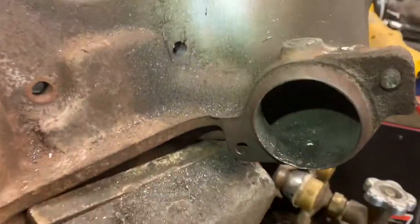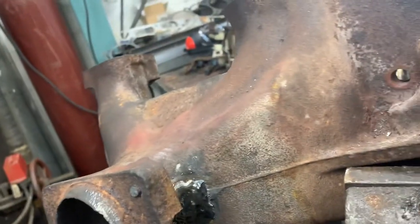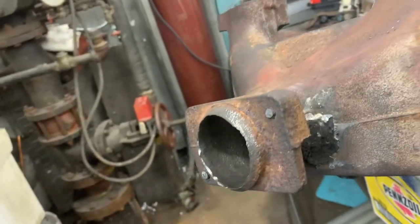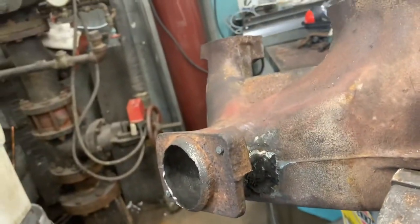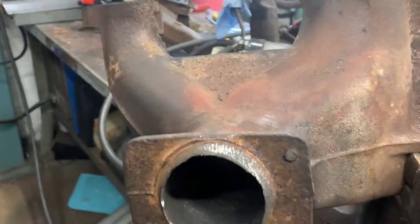We're done. You can see I ported it pretty heavily inside, both sides. I welded up the heat riser holes. I'll lay a secret on you — I blew a hole through it. I went too far when I was trying to get this angle. So I had it MIG welded. Luckily it MIG welded — most manifolds you have to stick weld, use a nickel rod or TIG or whatever. But I MIGged it and it MIGged fine. I'm pretty confident it'll be okay. I went back and re-ground it on the inside and it seems pretty strong. Hopefully when I heat cycle it once or twice the whole thing won't fall out and sound like a motorcycle.